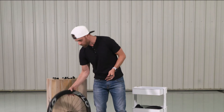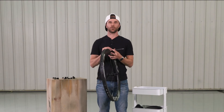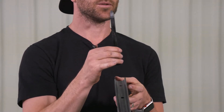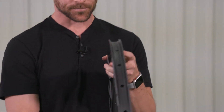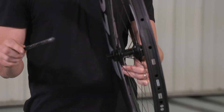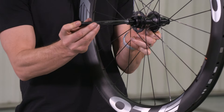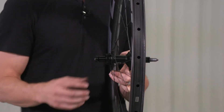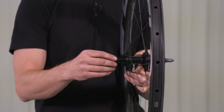This is a 12 mil through-axle skewer. I actually have a wheel here to show you what this looks like. There's no compression on this, and the reason for that is that there are threads on the end of this skewer, and that actually bolts right into your frame. So you place the skewer in just like this, and when you get to the end, you tighten that down with an allen key, and that threads it directly into your frame.